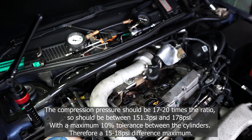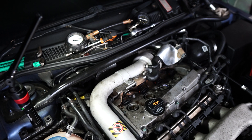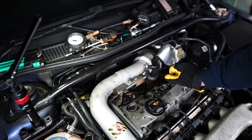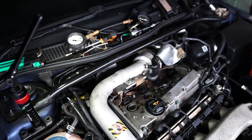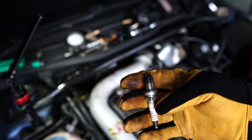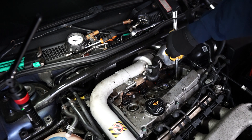They're all much of a muchness, so if all four are okay we're alright. It is a tired engine — it's done 170-something thousand miles. If we were going to do a big turbo we'd definitely have to look at rings, check the bore, and the valves might be a little bit carboned up. But generally that's not too bad — I'm really happy with that. We can go ahead and do a service and get rid of that absolutely minging leaking rocker gasket — that'll be one of the first jobs. I'll stick all the spark plugs back in; it had iridium plugs which is really nice to see.